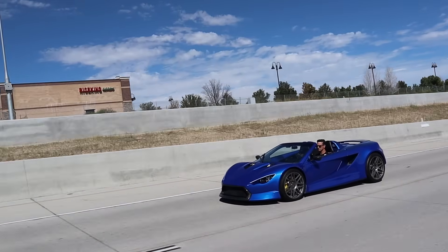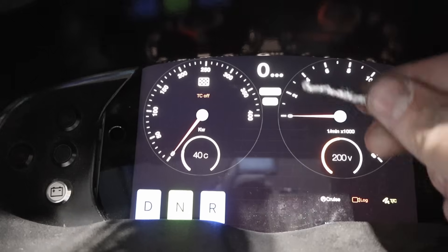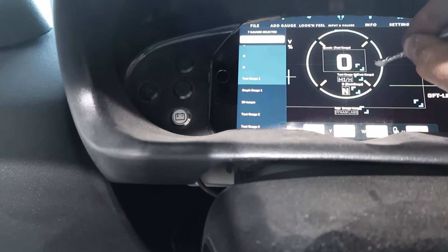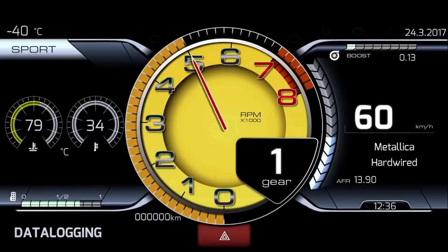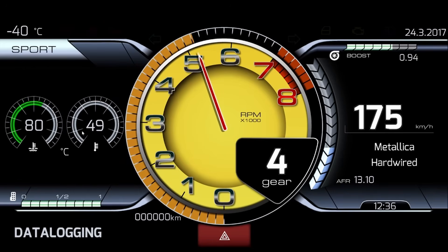They offer a lot of controls or ways to control. They've got PWM, high side outputs, and low side outputs — these are all ways to control various parts of your car, so if you want something to turn on or off at a certain time, those are ways to do that. The display is something different. The controller I had previously was pretty easy to set up with a display app, but it was only iPad and you couldn't configure it at all — there was just one app, all gauges displayed the same way. If you ever wanted a different background or a gauge to be bigger or smaller, there was no option to customize. This new one was way more challenging to set up, but you can then set it up exactly how you want — bigger font, different font, different gauges. I'll give a challenge to all of you out there: if anybody's got a really cool RealDash app or setup, send it to me. I think we can get them to have it be like their default app with a really cool background and gauges.